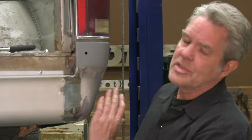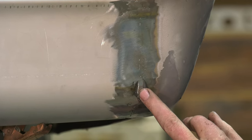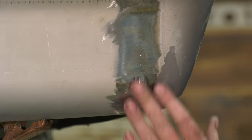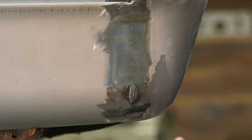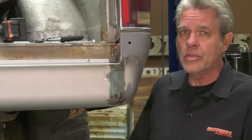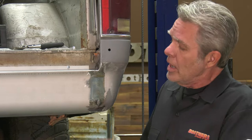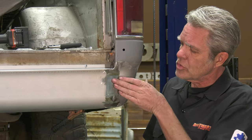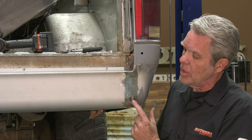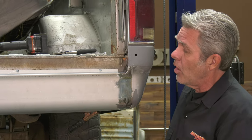You can see this just looks really nice smoothed out. I do want to show you this though — see how this still has like a harsh edge here. Sometimes when you're doing these welds they'll shrink in and you'll think that's smooth enough and that harsh edge isn't going to come back. But don't leave any harsh edges underneath, because it might phantom up on you later. If it was close to the surface when you sanded it down, after it dries and shrinks you might get a small anomaly right there that you don't want. So we're going to grind that all the way down.